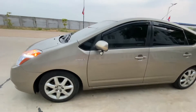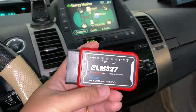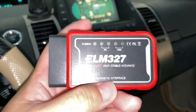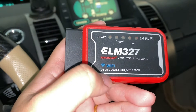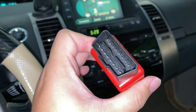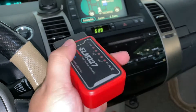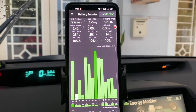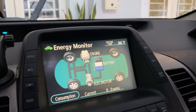So if you've ever wondered about your Prius battery health, you're in the right place. To get started, you'll need a specific tool for the job, and that's where the Dr. Prius app comes into play. I will use an OBD2 device for my Toyota Prius second generation. I have tried other OBD2 devices, but they didn't work. Fortunately, I found one working fine — it has ELM327 on it. This app is a game changer for Prius owners, allowing you to conduct a comprehensive life expectancy test on your hybrid battery.